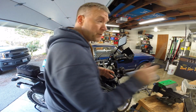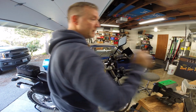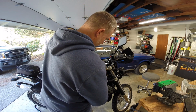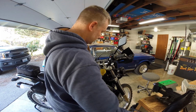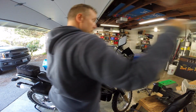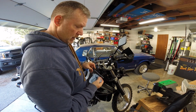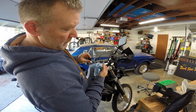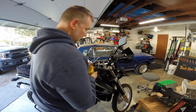So now this is where we start adding oil very slowly, just a little at a time, just a gulp, because it'll come up real fast. So we'll do a little there, get the dipstick out, make sure that's clean, check. Alright, now I came up, I'm right there where my thumbnail is, just barely, I'm into the lower hatch mark. Still not quite enough.